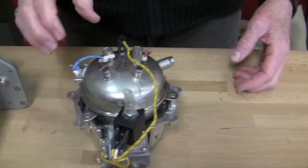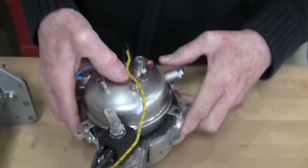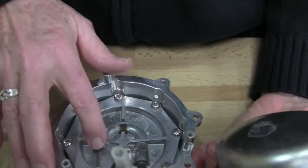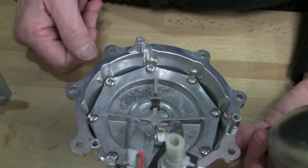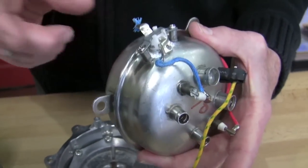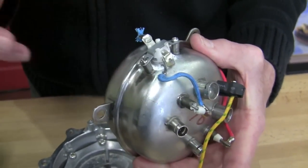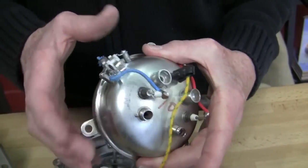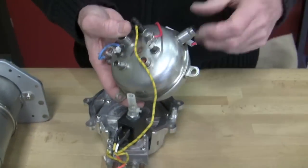It's a lot of force and it's always ready. This is the boiler for the brew side, and this is the brew head - it's right on top of the brew head. I took this apart on purpose to see what was under here. This is the coil that keeps the brew head at a constant temperature, and again this has a heating element inside of it. If I jiggle it I can feel it in there. And this is a thermostat that registers the temperature on the outside of the boiler to make the electricity kick in and out.